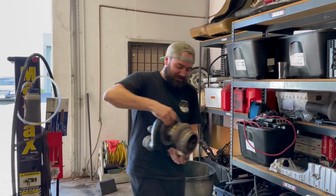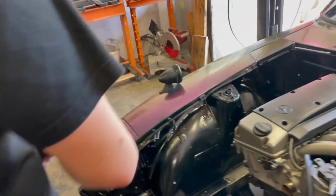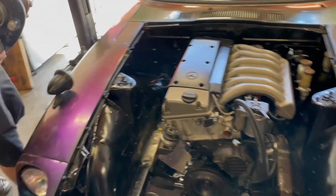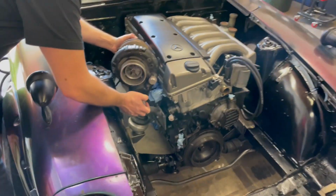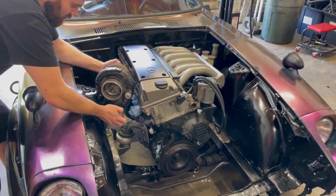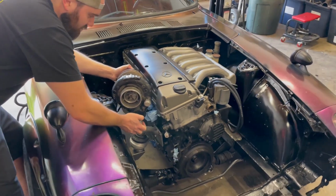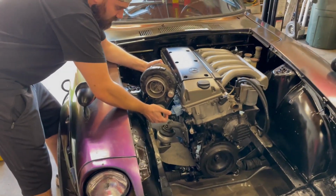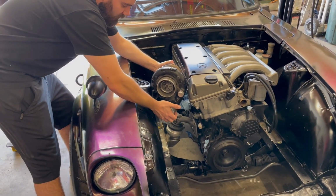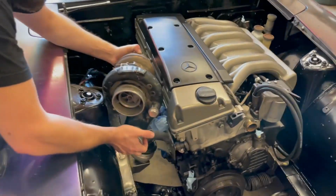We haven't decided on that compound thing yet, but what's likely to happen is we'll use one of these diesel truck turbos that we have. This is the HX35. It'll sit somewhere around here, by the manifold that we're getting. We've got plenty of room to the strut tower. Probably a little lower than that. Something like that, but we've got room for a big old turbo.